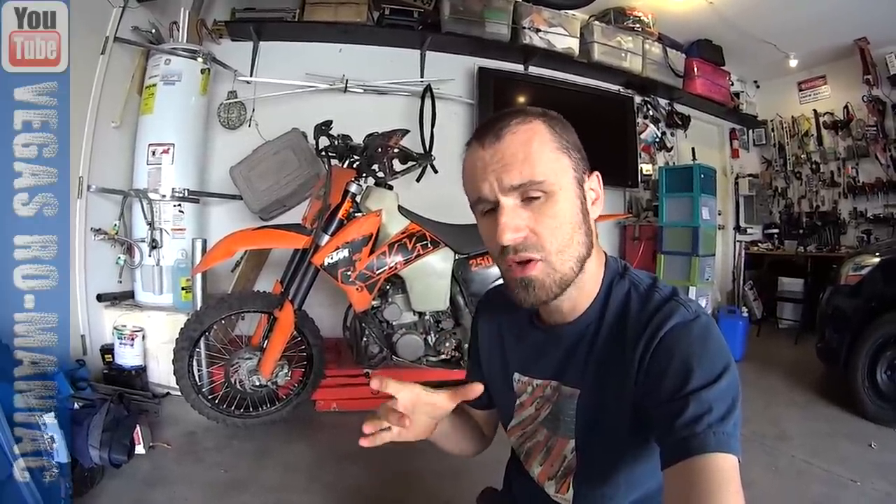This is maybe the most important information you're going to get from this video. Supposedly there are special seals called SKF — smooth as butter — sold a little more expensive than OEM. I tried OEM and I tried All Balls on this one. Next time I rebuild the suspension I'm going to buy the SKF, or I might even buy them now and just give it a try. Right now, even though these are new seals, they're very annoying because you have that little snag right at the beginning. Any small rocks just hit crazy, and then it's super smooth on heavy stuff. The suspension works — it just doesn't absorb those little rocks; you can feel every little bump because it doesn't move at low impact.